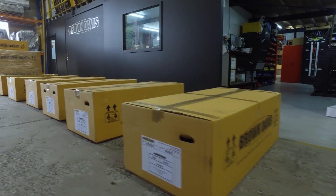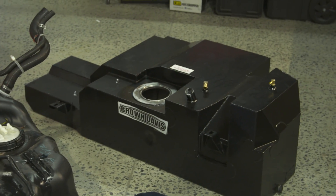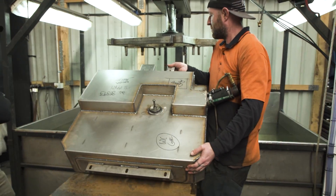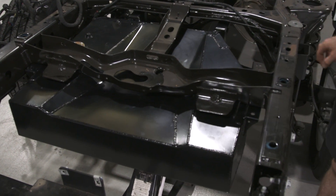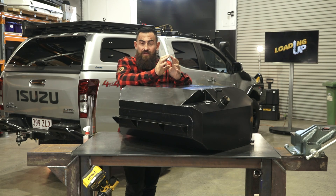The Brown Davis range of tanks can go anywhere from about 85 litres for replacement tanks up to about 185 litres — but check with the guys there on your application for your vehicle. They've also got swirl pots built in around the fuel pickup area, which is going to stop the fuel pump from running your engine dry when you're on some silly angles.